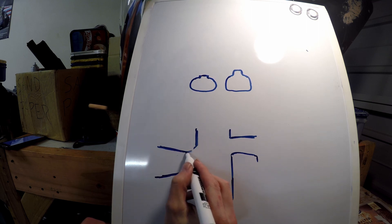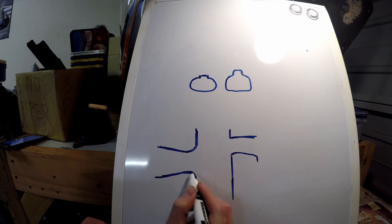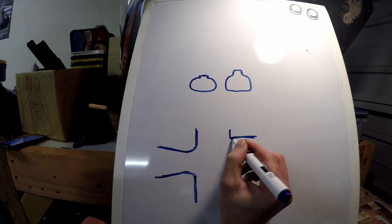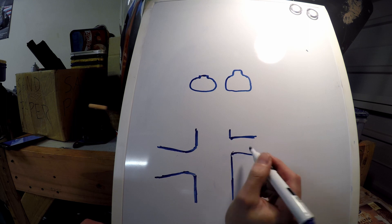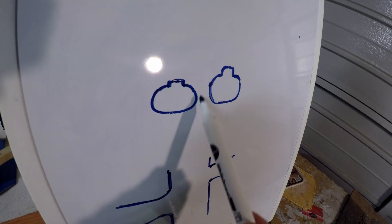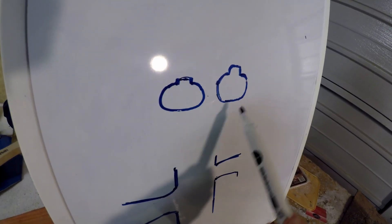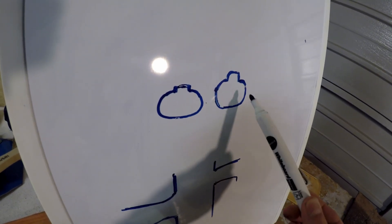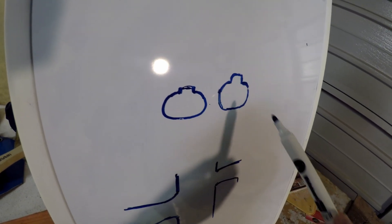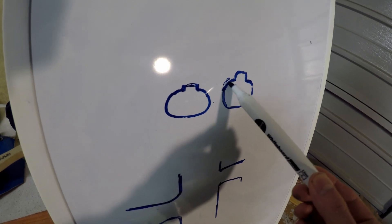What we want it to look like when we're done is a nice curve up to the boost port, we're going to remove that lip, and it's going to flow down like that. The exhaust isn't too bad — there's just a few casting imperfections and we're going to have them all cleaned up. Here's what it looks like down our intake with the restricted boost port, and this is our goal: it'll be a smidge bigger, nice and smooth, with the boost port up top a lot bigger and no restrictions.